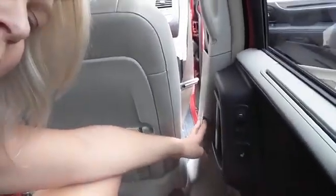Rear seat heater — let's see if it's... okay. That one didn't get fixed. Another one from back here is that this rear door doesn't always open with the button, so I'm going to see if that fixed. Oh my gosh, it fixed! The final result is that some of the things were fixed, some of them weren't, but it was definitely worth it to check those fuses. It could be something as simple as that, and it's so easy to check yourself without taking it in. Definitely keep some fuses on hand for when those things start to go, because they will start to go as your cars get older.